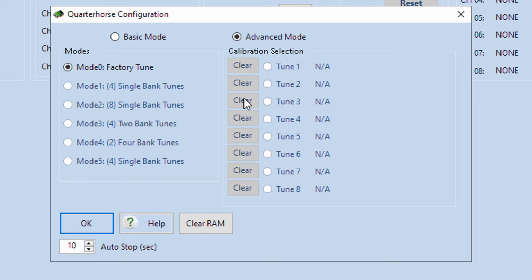It's a dial, or a little plug that has a dial on it that goes into a secondary slot on the QuarterHorse, and it allows you to change your tune whenever you want. And the same thing goes, there's the F3 V2 chip, so if you decided to use a Jaybird with just the chip that gets flashed, same thing, it has a port there, it can run multiple tunes, and you can use that selector dial. It's an easy way that you can just route that up to your glove box or something, and really anytime you want, you can just flip the switch and change tunes, so it's nice and convenient.